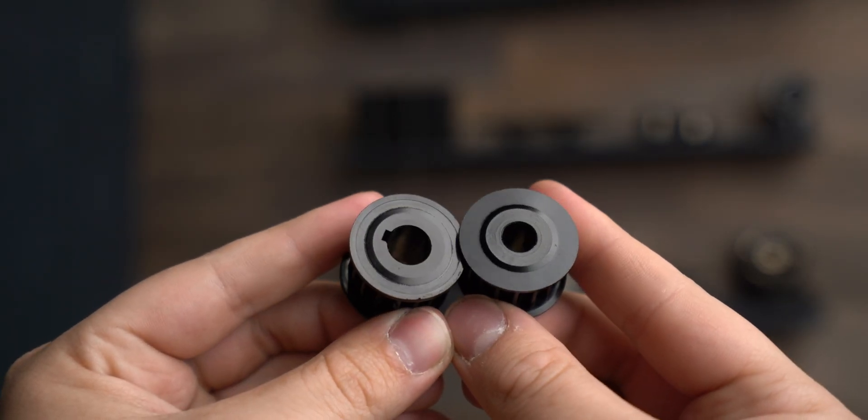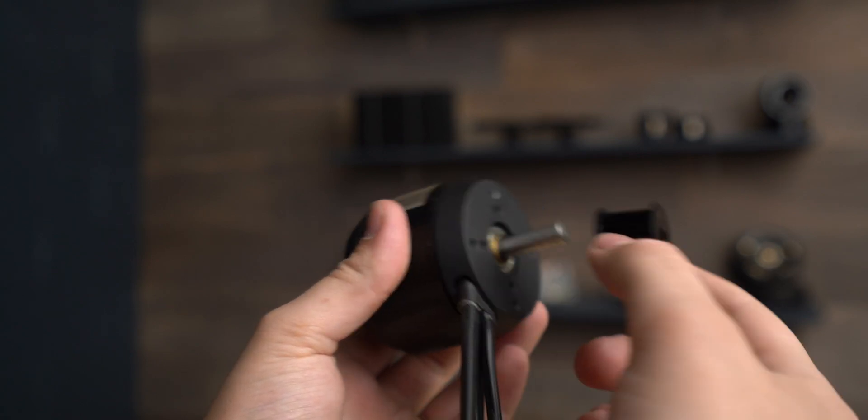Another item that people buy wrong a lot is their motor pulley. A lot of times people don't pay attention to what size motor shaft they have on their motor. Most motors in the electric skateboard world use 8 millimeter diameter shafts, but a few of them are 10 millimeter. What happens a lot of times is somebody buys a motor with a 10 millimeter shaft and then gets an 8 millimeter diameter pulley — obviously 8 millimeter is too small to fit over a 10 millimeter shaft. So take the extra minute, double check what size you have, and buy it correctly the first time. Nine times out of ten when we have to get a return started for a customer who bought the wrong parts, it's one of those parts. Hopefully this video makes you read that extra line item in the description and compare all your parts making sure that everything is bought compatible the first time.